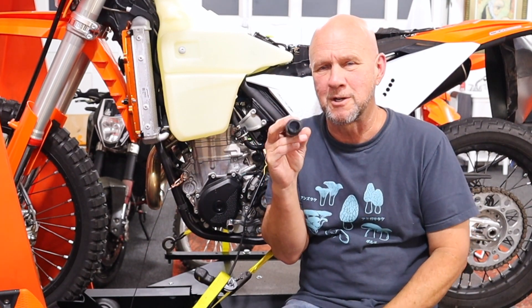Everything's going towards a super hot motorcycle. Just replacing this tube on your stock bike to cool it down — I don't think it's really going to do a thing, honestly, because you haven't gotten rid of the first weak link. All that pressure is still going to back up in the stock muffler end cap and it's still going to climb straight up to a really hot temperature.